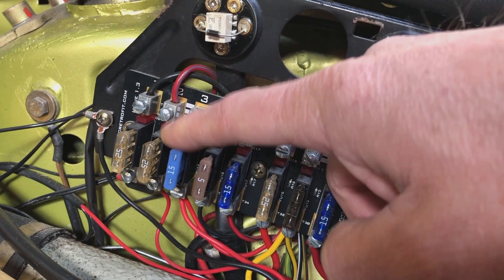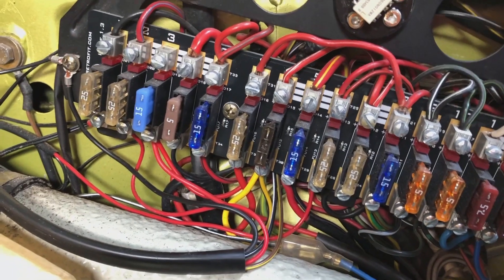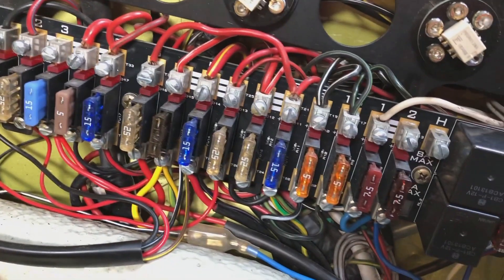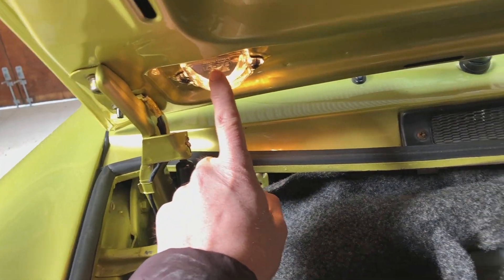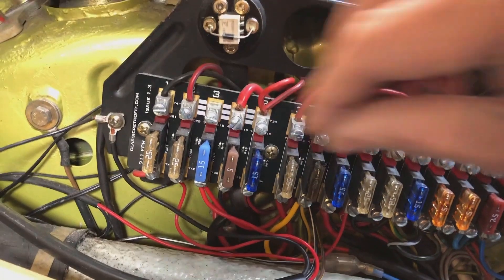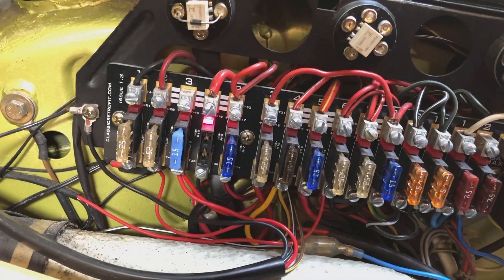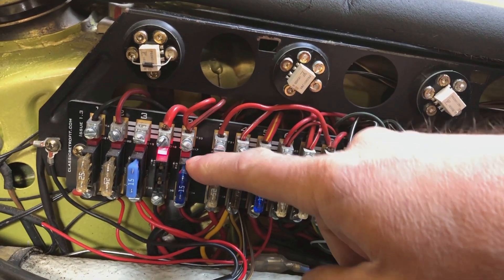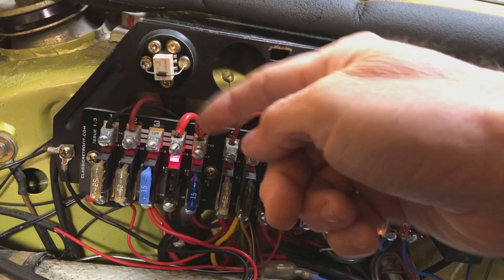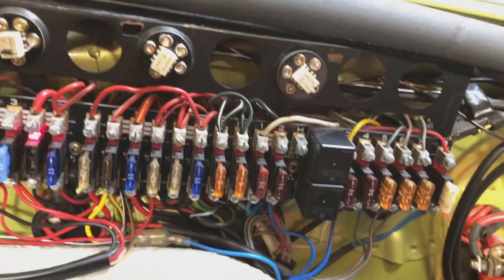Under each terminal, between the fuse and the terminal, there's an LED hidden in there. These are really useful for detecting whether your fuse is blown, but also for diagnosing wiring faults in the car. If we pull the hood fuse to simulate it blowing, you can see that the LED comes on to indicate that. It's also worth knowing that if you're doing a restoration and you've just put the wiring loom in, taking all the fuses out means these lights can be really useful for diagnosing all the switchgear, because they will only light when the circuit is powered. So that's quite a neat little feature.